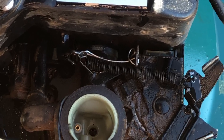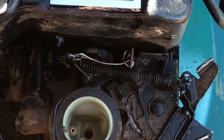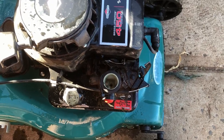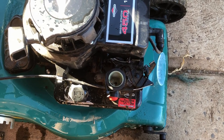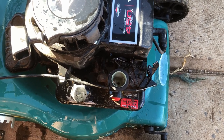Not to worry. We'll go and raid a parts engine, another parts machine, get that sorted. And the revving up and down, probably just a carb diaphragm. And also on these, they run a very light bar blade, so just even the slightest downfall of your engine mixture can make these surge like buggery.